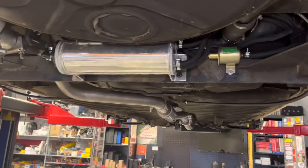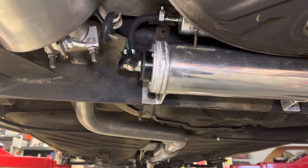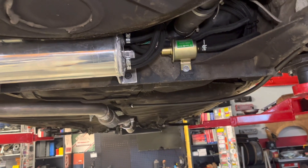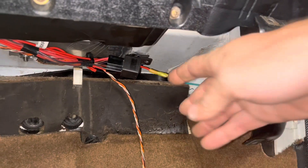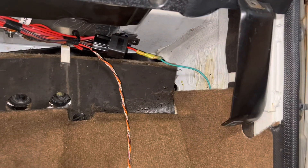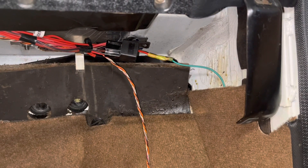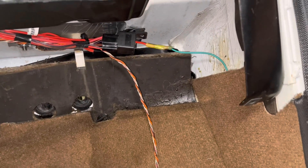On this diesel car, I had to basically add a fuel pump system. So I put in a lift pump that feeds a can that houses a Bosch 044 pump. Then I had to make a harness go through the floor pan right where the fuel sending unit went, and I ran that wire all the way up to the ECU. I'll show you that connection here in just a second. We're under the dash of the diesel car and I've got my relays positioned over here — this will get loomed and tucked up a little later. This is the fuel pump power wire that I pulled from the back of the car since this car did not have a fuel pump in the back. I grounded it to the same point on the chassis that the fuel sending unit is grounded — I did not use the fuel pump or the fuel sending unit ground, but just the same grounding point. Your fuel pumps will need their own ground.